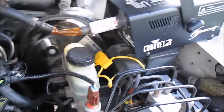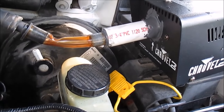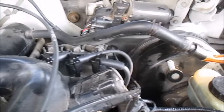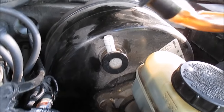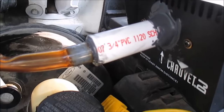I'm going to show you what I got here. I got my fog machine that I altered and modified. I'm going to try to smoke out my intake and find where my vacuum leak is. I have it going to my brake booster hose. Basically all I did was I unhooked my brake booster from there and I added some fittings to fit my fog machine.